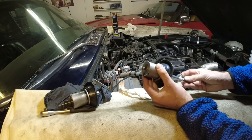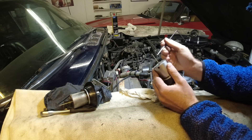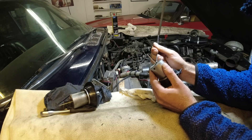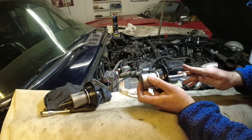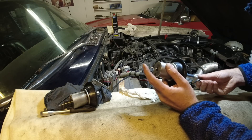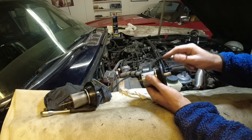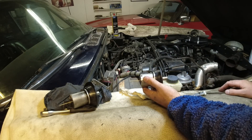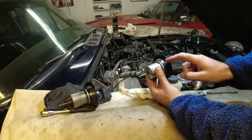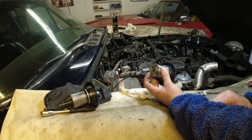Sometimes it's good to have things laying around. As you can hopefully see, I am moving the needle out and I can move it in as well. I'm going to set it to the base setting - they call it a Delrin ring I think in the manual - where the ring at the bottom of the needle should be completely flush with the bottom of the piston. I put a different diaphragm on it as well. Sometimes you find really weird things, and ideally maybe we would need a rebuild kit and some other things, but it's going to be hard to get a hold of these. All the needles are set the same way, we'll let it warm up, and then we should try and balance everything.